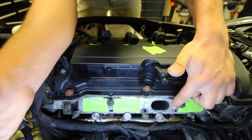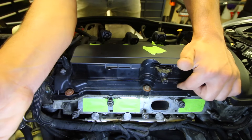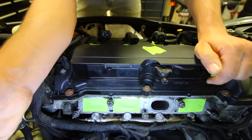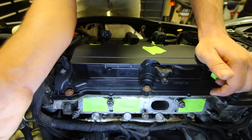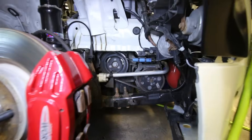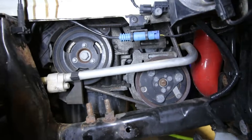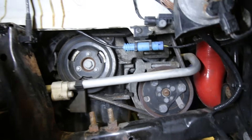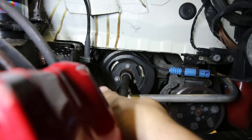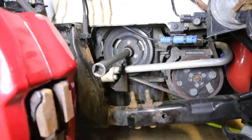It's very important to keep the valves closed — I can't stress that enough. If you don't know how to do that, you can jack the car up and there's a bolt on the crankshaft you can turn to whatever degree you want and check that the ports are closed. To manually crank over the engine, go into the fender liner in the wheel well area and find the crank pulley. The one in the middle of the screen is an 18mm, so you can stick an extension with your 18mm socket on there and literally turn the engine to the position you want.